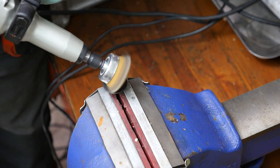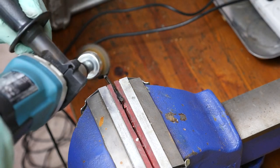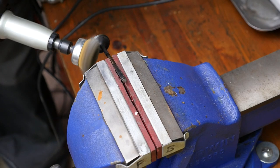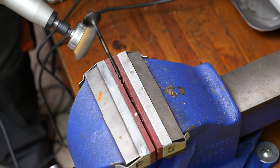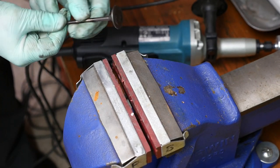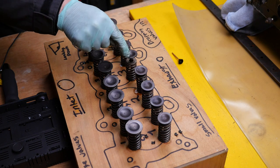Now to clean the 16 valves. I'm going to use a Makita die grinder with a wire brush. I'm not going to go excessive because I certainly don't want to cause any damage. I'm not going past where the carbon is on the actual valve stem because I don't want to go where the seal is — the rubber seal that stops the oil coming down. So I'm keeping all the cleaning work to below where the actual carbon has built up, as you can see I'm not going up the stem. Then it's just a case of working your way through all 16 valves.